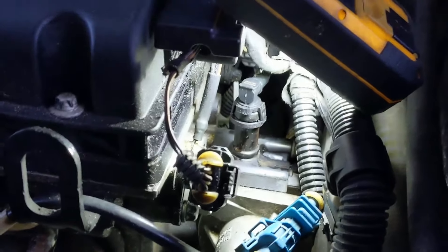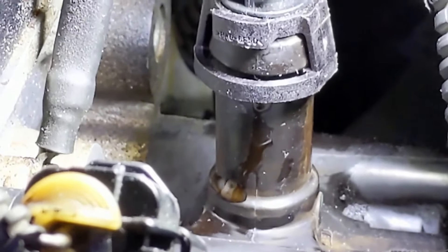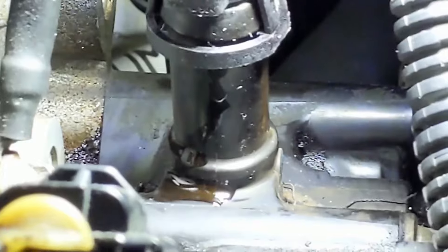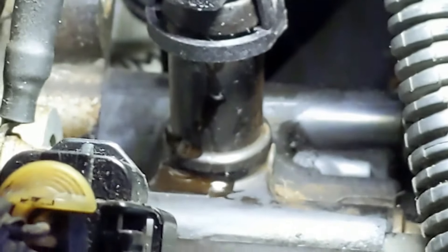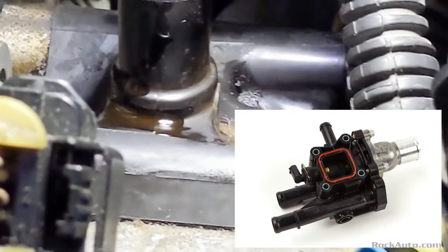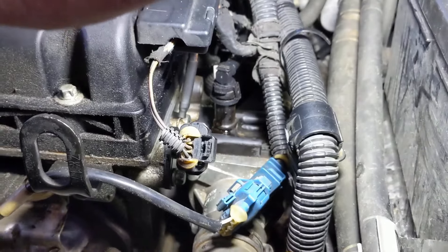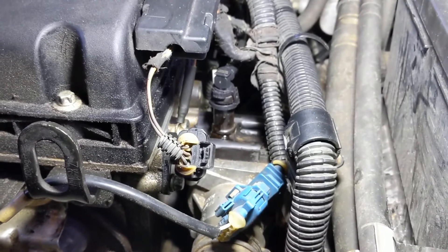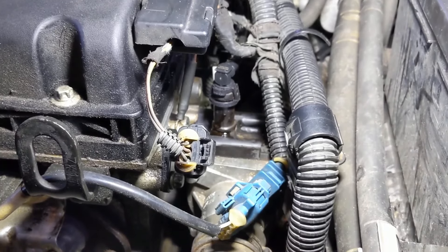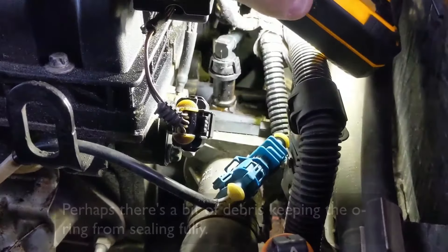Good news bad news. I'll zoom you in - you can still see a tiny little leak, a little ripple. The car is at temperature but it is pooling. That's frustrating. I'm wondering now if the stem of that thermostat housing is cracked, and if it is, that probably means I've got to replace the whole thermostat housing. It's disappointing, but the good news is I know that pipe is not broken off down in there anymore. I'll run it a couple days and see if anything changes - if it gets worse or better.